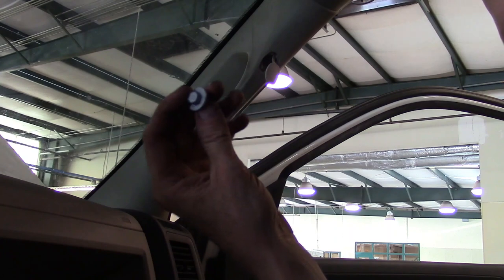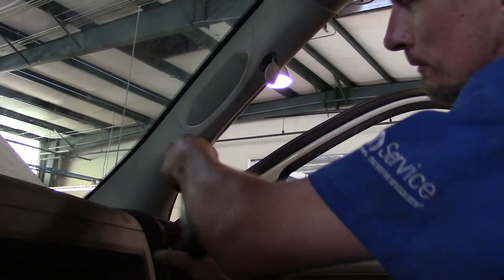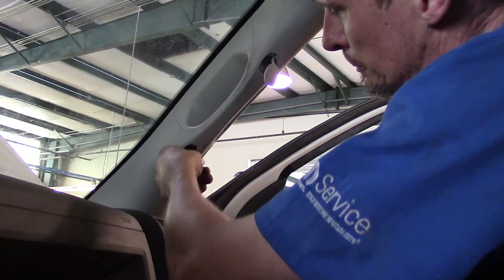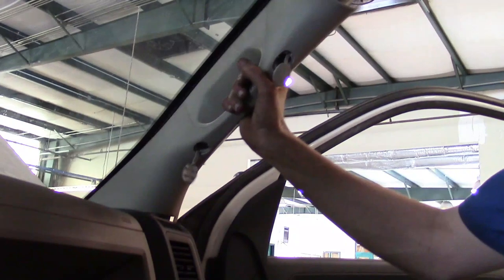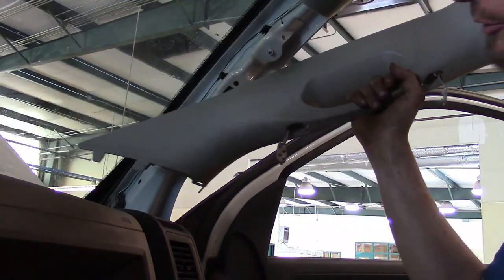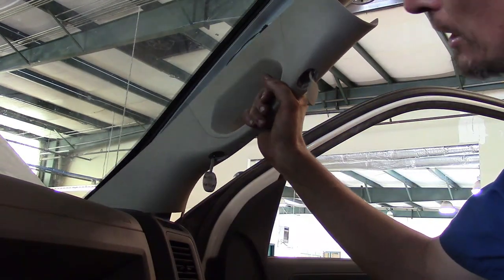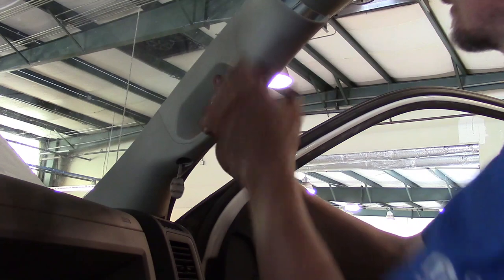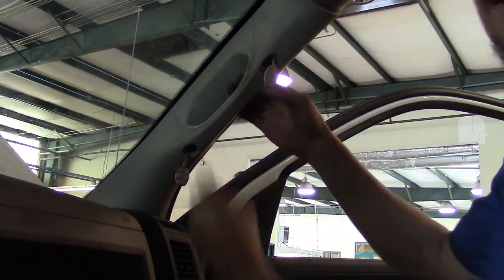Keep in mind what bolts go where — these are kind of gray in color with a flat washer, just remember as you're going. All I have to do is grab the handle and pull and I can set it to the side. Now when you're going back with it, you've got some little plastic fingers right here you need to line up — it's almost like a little track up here on top of the dash. You line it up, put it down, and line up where the plastic snap is because it does snap in place. You still have your bolts as well, so you definitely have to unsnap it to get it off.